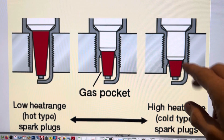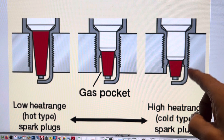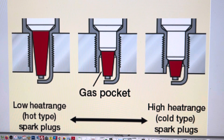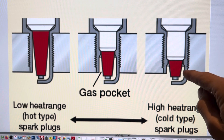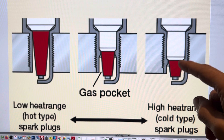If you run a spark plug in your car that's too cold, it won't get hot enough to burn off carbon deposits from combustion inside the chamber. The combustion temperature depends on whether you're running a lean or rich mixture and the running temperature of the engine — which is why the spark plug is very specific to the engine. If you put a colder spark plug in, the tip may not be hot enough to blow off carbon deposits, and after a while you'll start to get rough running, misfires, and fouling.